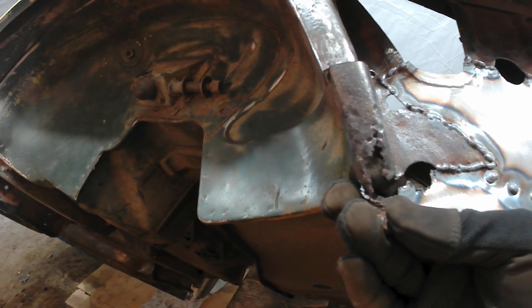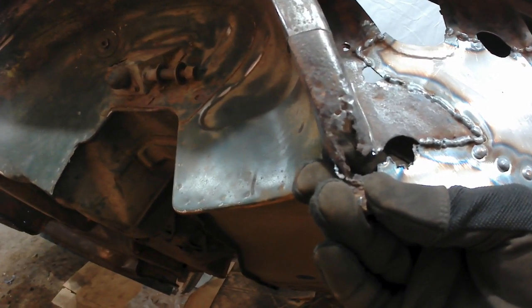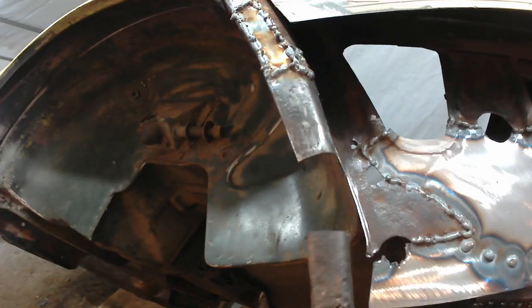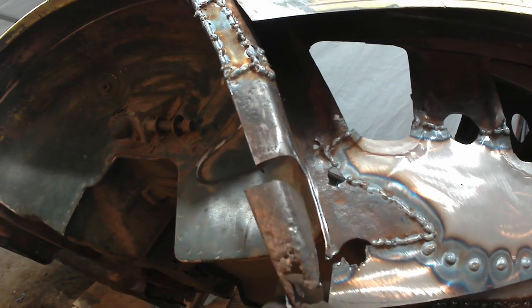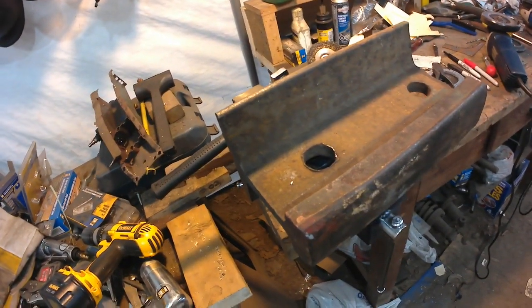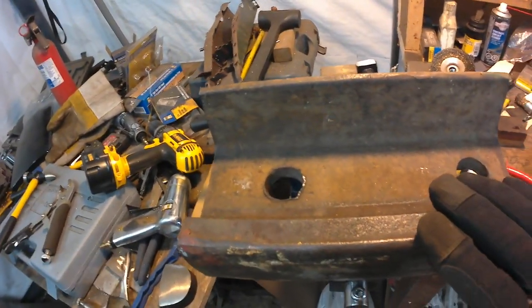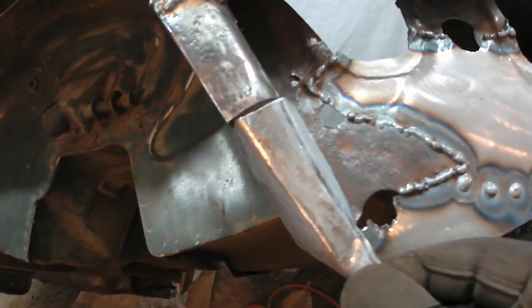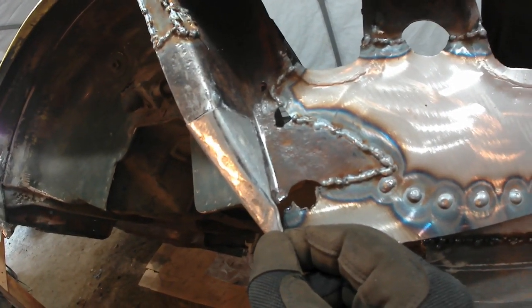There's this last little bit at the back of the fender well on the bottom. I've cut this out, and then kind of as an exercise in 'I wonder if I can do this,' I started beating on a piece of sheet metal. I've got this anvil — well, not really an anvil, it's actually a piece of old railroad track — but it might as well be an anvil. What I ended up with is this piece. I knew how it looked before I started recording, so I'm going to tack that in there.